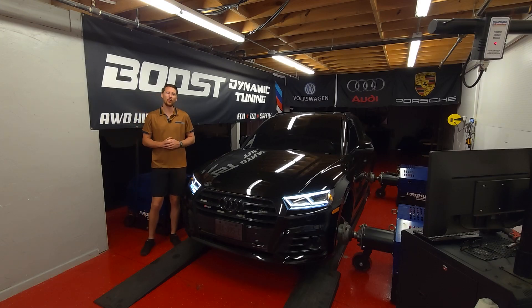That was quite the job — downpipe, intercooler, turbo intake pipe, and a cold air intake. The data tells you where you're going to make power: get a downpipe and a front mount intercooler. If you're a stage one guy not looking to mess with the exhaust, just knock out the front mount intercooler and be done. Front mount was about an hour, turbo intake was pushing an hour, and so was the downpipe. The downpipe is absolutely worth it — we gained serious power with no tune change.